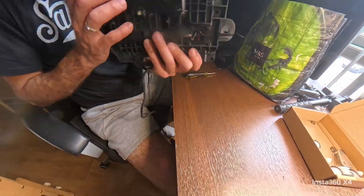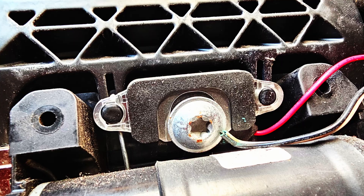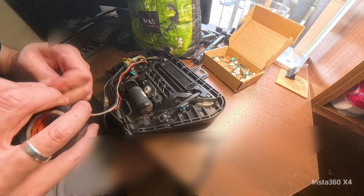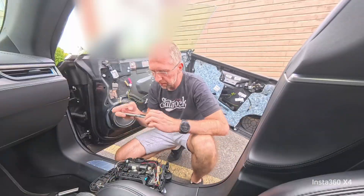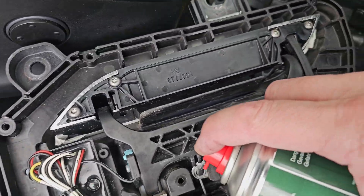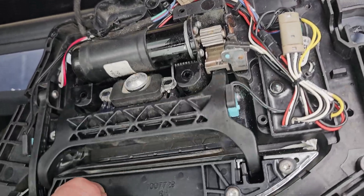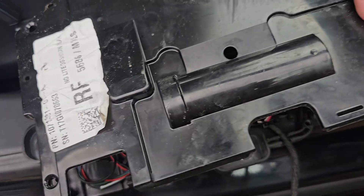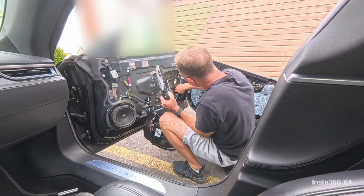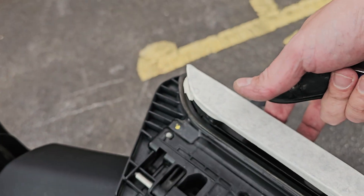Microswitches and harness have been changed. But now I'm trying to figure out what's above the motor — where these 3 cables broke off from. AI suggested some light source; I think it's a sensor, but no idea for sure. Time to tidy up the wires. There's one more thing to sort — a terrible squeaky spring. It's gone now, such a relief. Time to put the cover back, connect the door cable, and test it out. Make sure the door is tricked into closed. It works, even with this mystery element disconnected inside.